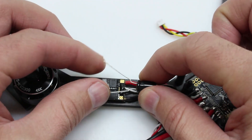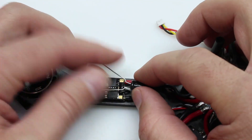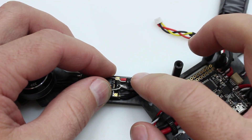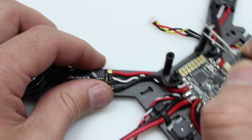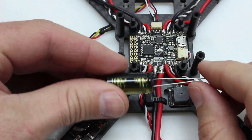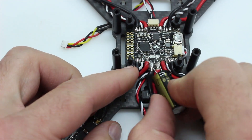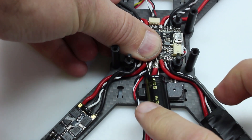You simply solder it on, and to make sure it doesn't go anywhere, you can put electric tape around it, or zip tie — whatever you like to do. This is a very effective way. Four caps actually do work better than one individual one, but if your build doesn't allow for that, you can get one large capacitor, just like this one. Short is negative, long is positive. You can wire them right in here and just secure it down to the back of your frame.